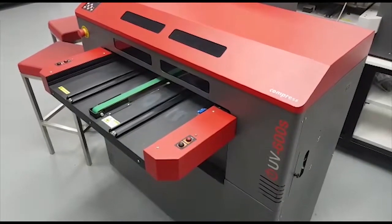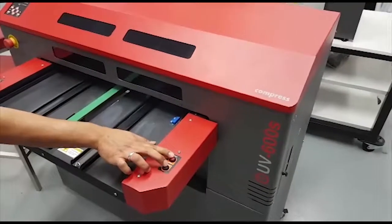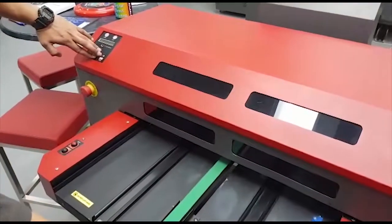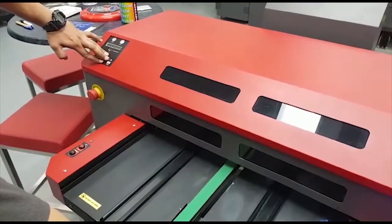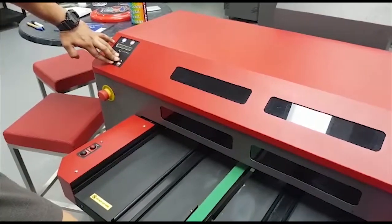To start with, we will go into diagnostic mode by holding the load and eject buttons, reverse next and forward on the control panel — hold all five together, and then turn the power on. Keep these buttons pressed until you see 'Check Test' on the control panel screen.